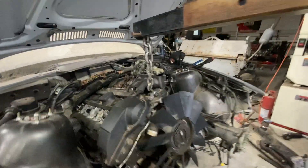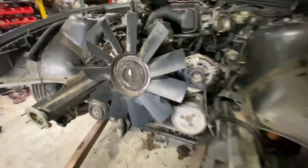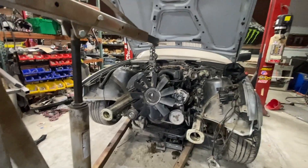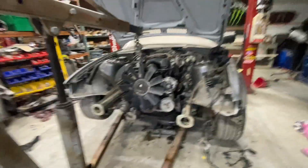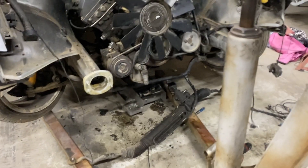While we were filming the rope snapped, so we switched to a chain and tried to get the motor out. We shortly realized that the steering rack is blocking the motor from coming out. So right now I'm going to start by taking off the rack and pinion, and then probably dropping the sway bar if I have to, and then the motor should be able to come out. I got the rack and pinion out — let's see how this goes.